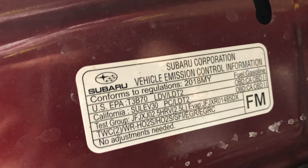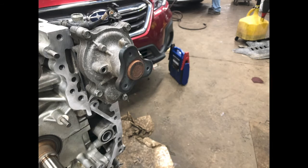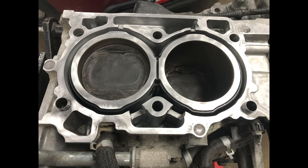It's got the 2.5 engine. Found the coolant temp sensor wasn't the issue — it was just meeting its threshold of 240 degrees because of the overheating concern. There weren't any external coolant leaks anywhere; the coolant was still showing pretty much full in the reservoir and radiator. So we decided to do a block test on it to see if it had an internal coolant leak, and it failed the block test. We concluded it was a head gasket issue.